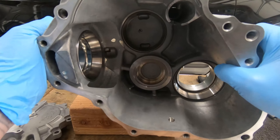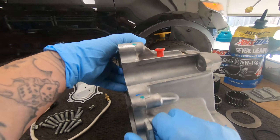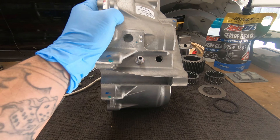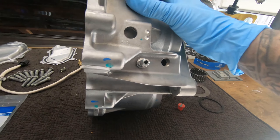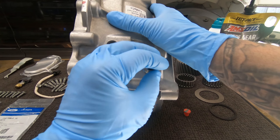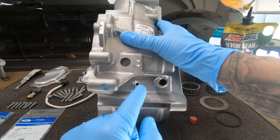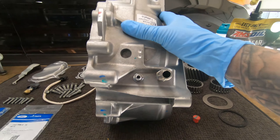Let me show you here. This is the vent — it's really small, probably less than a quarter inch, like 3/16ths. Now, if you notice, I drilled here, and that's what I'm going to be adding this fitting to. Essentially, this is a 3/8ths hole that will fill, and the displaced air will come up the normal vent. So you have a simple path for the air to go.